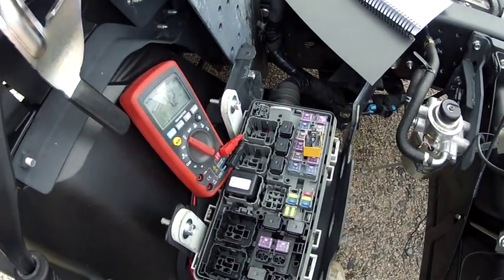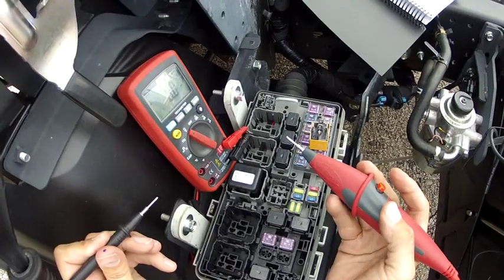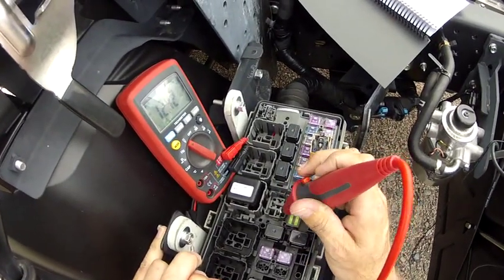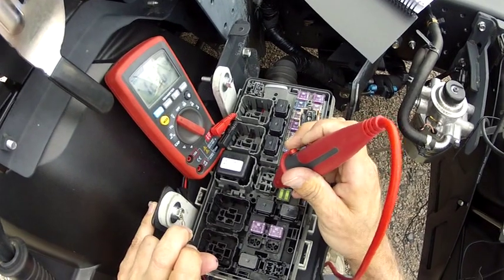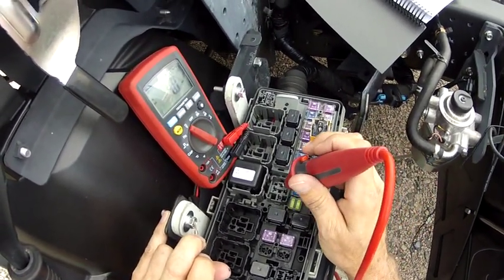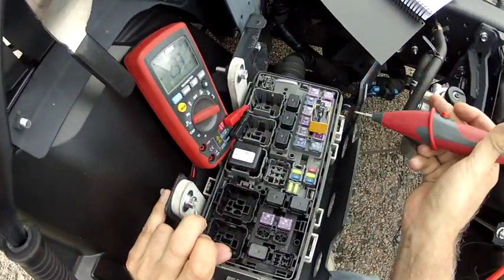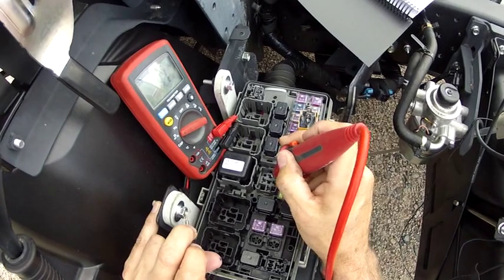Volts. Zero voltage on the ground side: that's a short to ground. That's open. I go into 30, system voltage, immediately load the circuit. Voltage doesn't change. The wire coming to terminal 30 is fine back to the battery. I go to ground through the clutch, I see I have continuity. I confirm that's what it is. I move to ohms. I expect a fairly low number, and sure enough, I get 4 ohms.